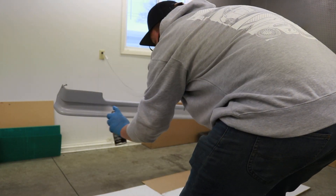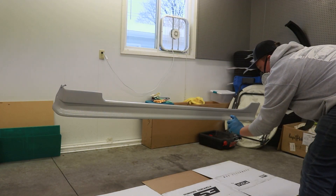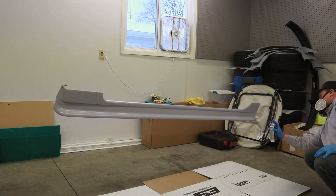It's been about 10 to 15 minutes. We're going to go ahead and lay the second coat of primer. We're going to let the primer dry for about an hour or so and then come back and check on it. I want to see tonight how it holds up to wet sanding and getting it prepped for paint. Because if we run into any issues there, we'll know what to take care of for the other side skirt and potentially the over fenders. I wanted to knock out this one first, just to make sure I'm doing the process right and not messing anything up. The side skirts I was a little worried about because the wrap did not want to stick to them originally either.